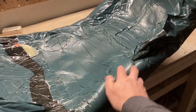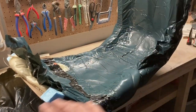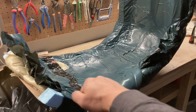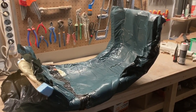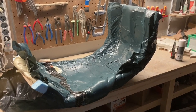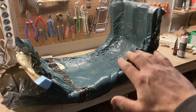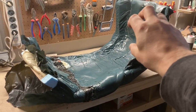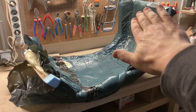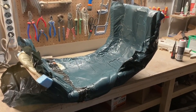And I have to cut all that off, so that's waste. What I should have done is put the seat in the bag, then wrap it all up, adjust it to the width of the seat, and then do the foaming. Furthermore, I did it in batches — that's the way to go. Because if you do it all at once, the foam would be liquid, it would start to set off, get semi-rigid, and it would not flow up. So definitely do it in batches.